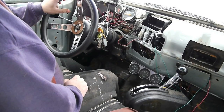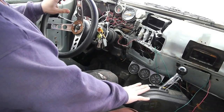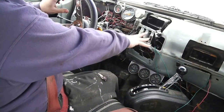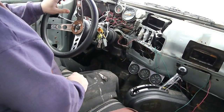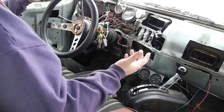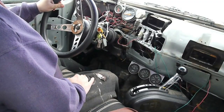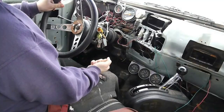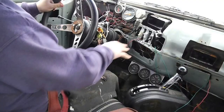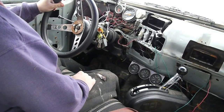Full line pressure means somewhat harsher shifts — actually quite a bit harsher. It's really only noticeable going up into second and down into second. I was also concerned about what happens if I bump a switch while shifting at 55 miles an hour — will the truck downshift and cause an accident? The answer is no, because the solenoids don't cause the gear to hold like a column shift in first gear going down a hill. You still have to use a regular shifter to actuate the physical linkage.